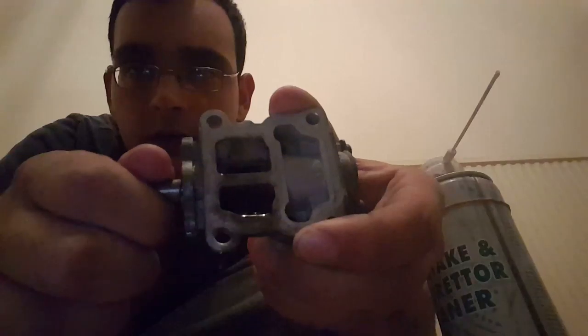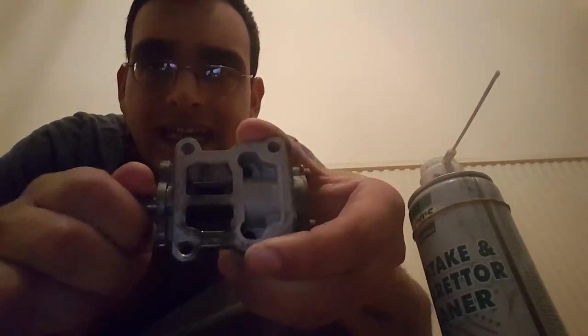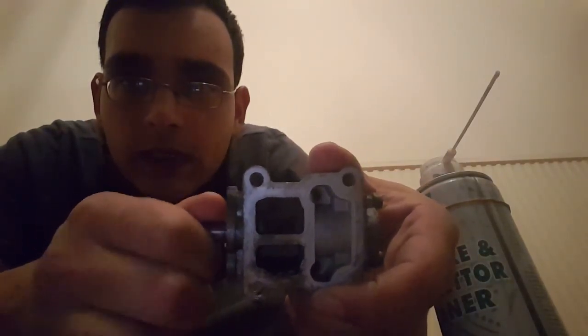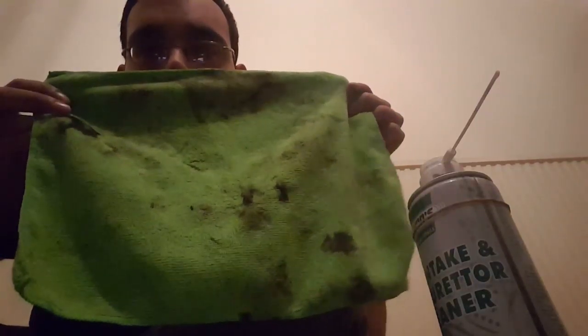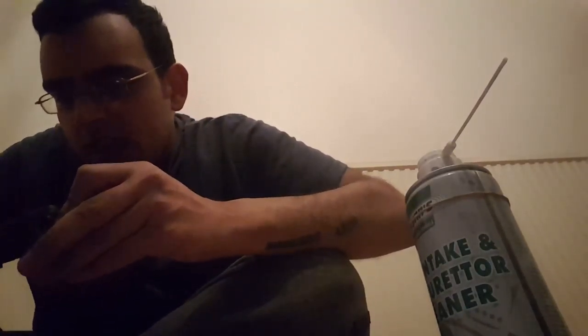And there we go — look at that, stiff as anything, but it's still stiff. Oh — you hear it? It now moves! And it should be able to open all the way. So you just work it. This cloth I used on the one that's on my car — as you can tell, very very dirty. Also do this outside because it's very strong. It's half ten at night doing a little how-to on how to clean your idle control valve for your Honda Civics.